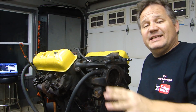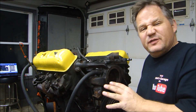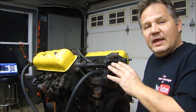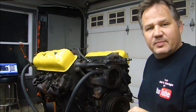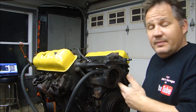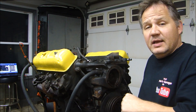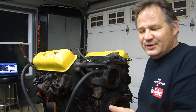It took a lot to get the engine to this point — at least get it on the stand and ready to disassemble and inspect. I'll make these videos short so you don't have to sit and watch for hours to see progress. The next video will actually be tearing down the engine — pulling it all apart, taking out the components and inspecting them. We looked at cylinder pressure, spark plugs, and the intake, found an exhaust leak, and measured uneven pressure. We know that cylinders five and six are going to be a problem, and I suspect we're going to see a lot of oil on the valves inside the heads — a lot of things that go along with 135,000 miles and 58 years of running.